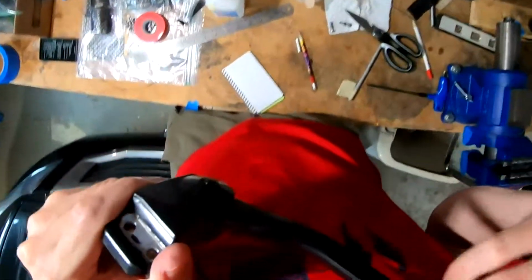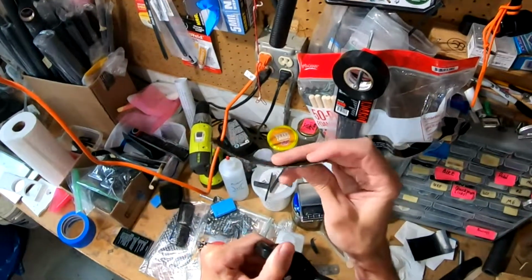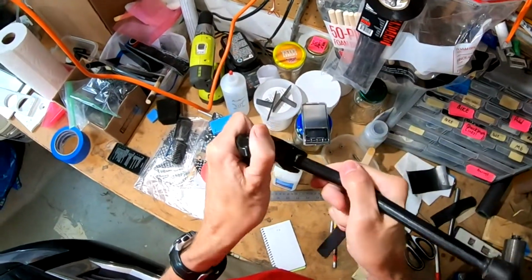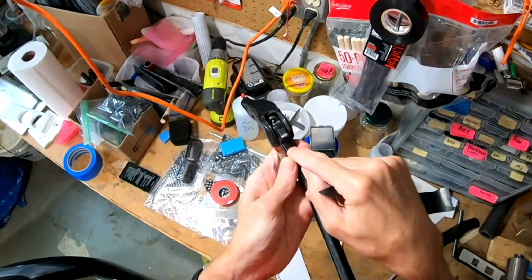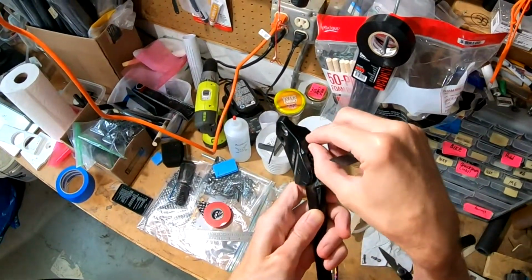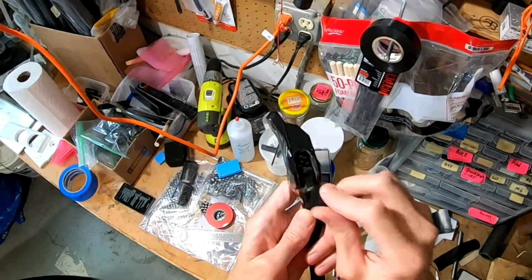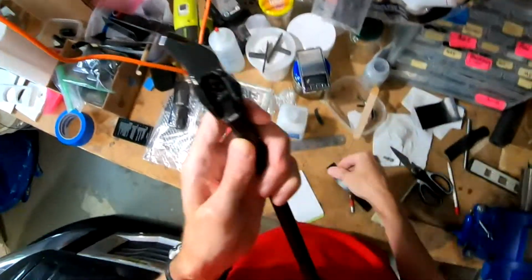Another solution I had was to take a little bit of this stuff, which is just protein powder jar plastic. It's pretty thick, about 1.5 millimeters thick. And if you carefully duct tape a piece of this on to here, the duct tape running from here to here, and a little strip of the plastic right there, it will be in here, and it's shock absorbing enough to eliminate that sound pretty much entirely, actually. And it's tough enough not to fall apart, but the tape will eventually break.